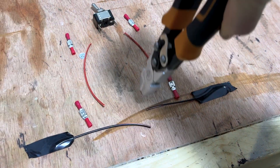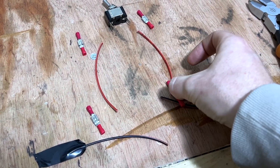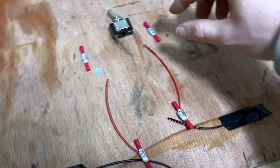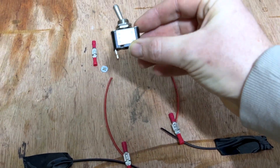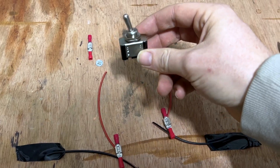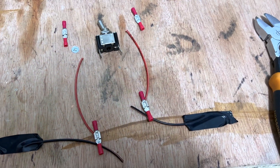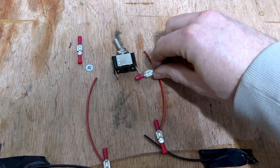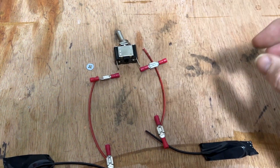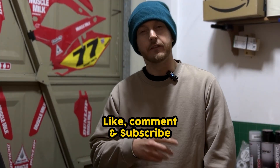What you will need to do is wire into the fuel pump cable, then wire one side of this cable to your button cable and the same with the other side. With the button or switch, hide it creatively in your car somewhere. Obviously, because it's a switch you will need to operate it, so it needs to be convenient enough for yourself to use every time you get out of your car, but also inconvenient enough that a thief won't find it in five seconds.